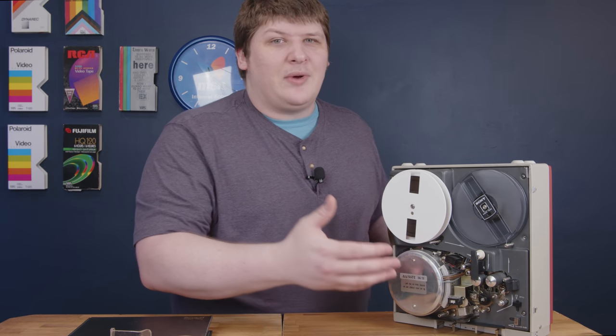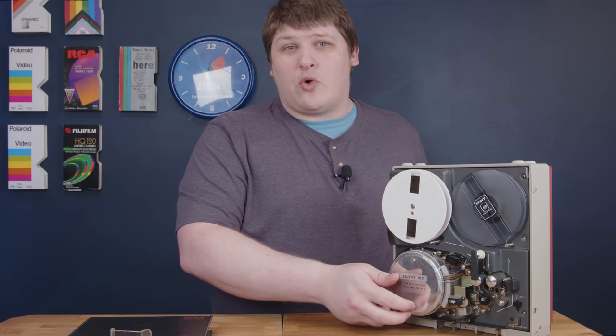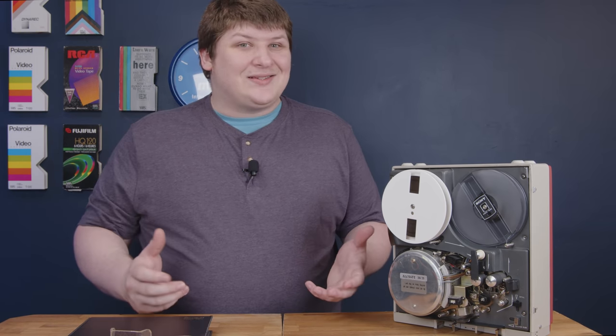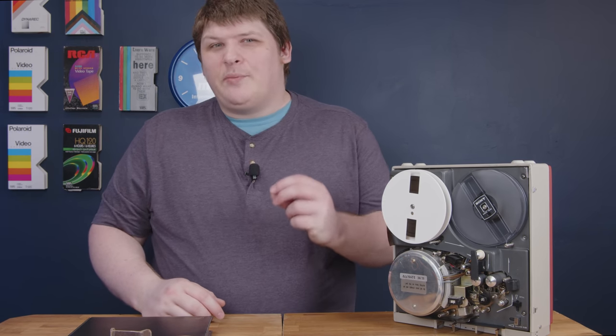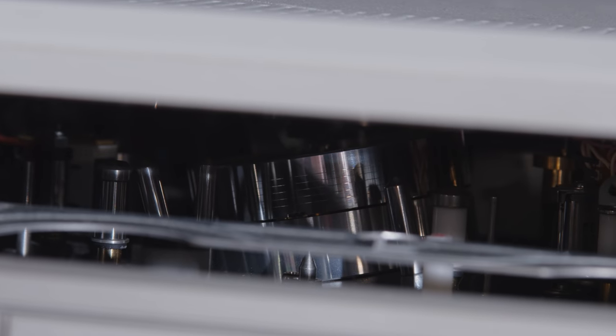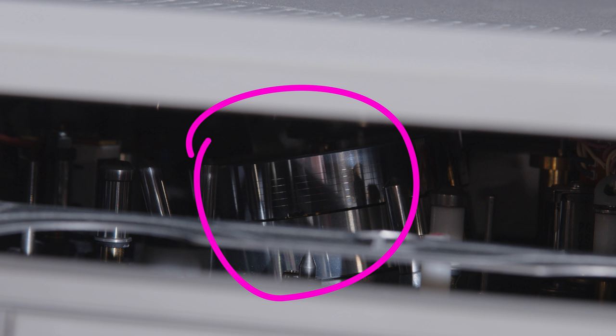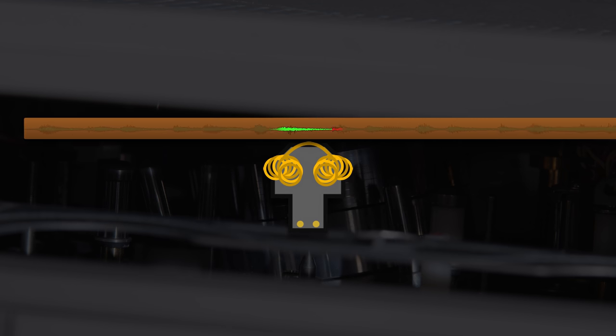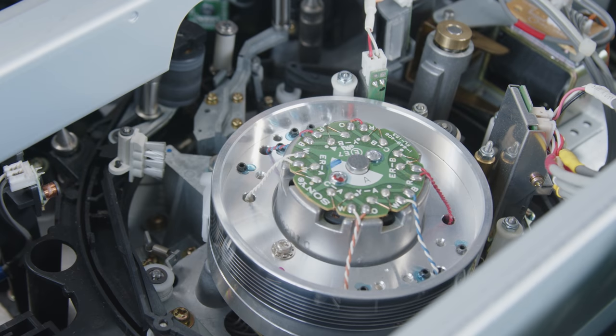The money zone is this video recording head — it's definitely completely alien compared to an audio tape machine, but it's also pretty different compared to a typical VCR. In order to explain those differences, I'm going to have to tell you a little bit about the theory of video recording. If you peek through the flap on a VHS deck, you'll see immediately the most interesting thing about VHS: the tilted metal cylinder in the back, called the drum assembly. It contains anywhere from two to six video recording and playback heads — tiny elements with coils that can detect or lay down a magnetic signal on tape.